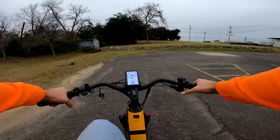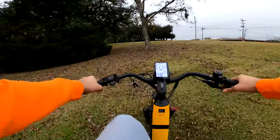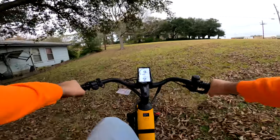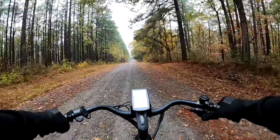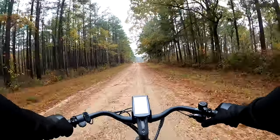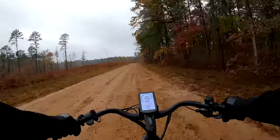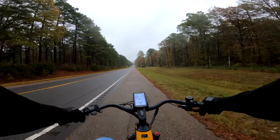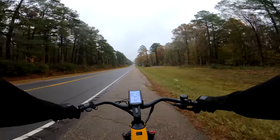They've gone with a Shimano push-pull trigger shifter, meaning that you don't have to change your grip to shift gears. Adding to this convenience are 2 full-size lock-on grips which will not rotate under riding conditions, but are easy to take off and adjust. Fat tire bikes in general are not usually fun to pedal, especially without power. The gear ratio on this bike doesn't complement low-speed operations very well, but it does match up to its top speed. At 20 miles an hour, the cadence is just right and your legs won't run away.